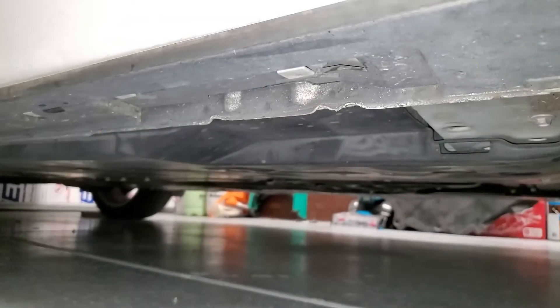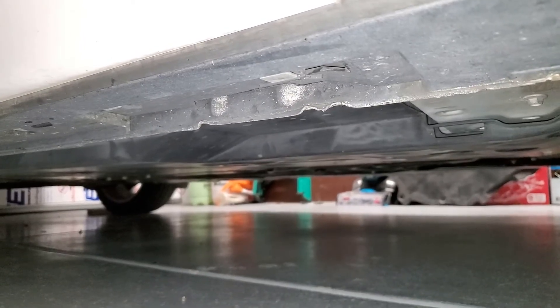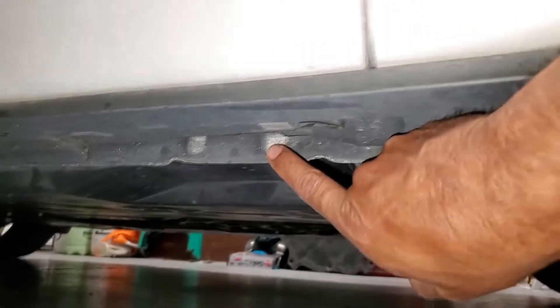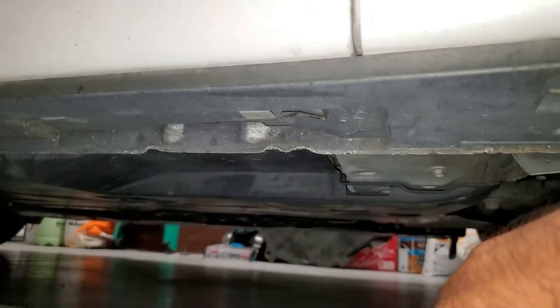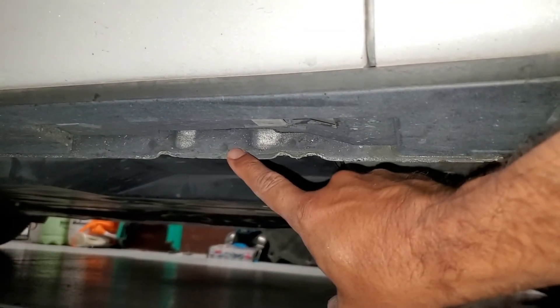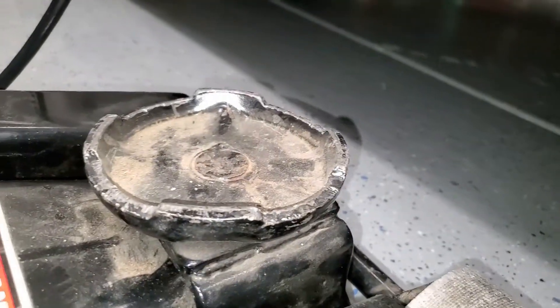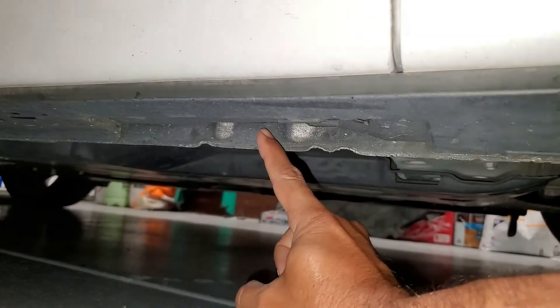When you're supporting the vehicle on a jack, these are unibody cars, so these cars will need to be jacked up in the area between these two nibs. You will support it right here by this plate on top, or if you're using the conventional jack that comes with the vehicle you will be locating it right in here.